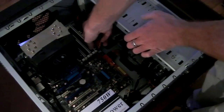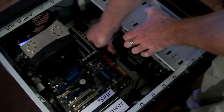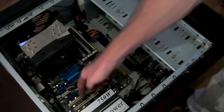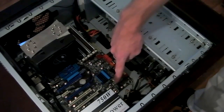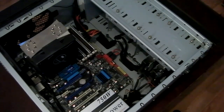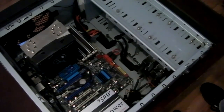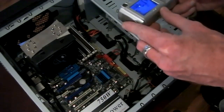The next thing to do is unplug everything from the motherboard, so you've got your 24-pin with a little clip at the side — that's removed. Now you have your connections for your front panel and USBs, switches and things like that. I recommend, when doing this, although I'm making a video of it and I don't really want to go back on the video to check everything — if you've never done this before and you're dismantling the computer, it's a good idea to take pictures first. But first, change your batteries in your camera because they've run out.